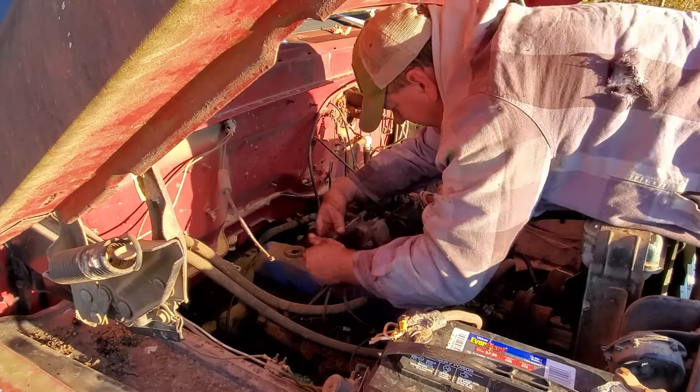It sort of looks like another master cylinder, but all it does is operate a valve that makes the booster work, and then that makes the fluid move to the brakes. If your booster goes out, you still got manual brakes a little bit, but it's a different setup from just regular old vacuum assist. But it looks like we're going to need a master cylinder, and he said the booster was out, but I think what we'll do, we'll just put a master cylinder on it first and see what happens with that.